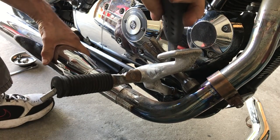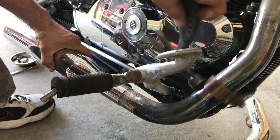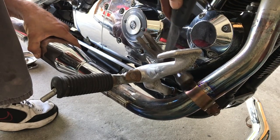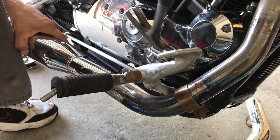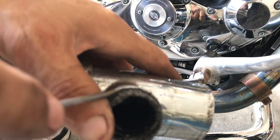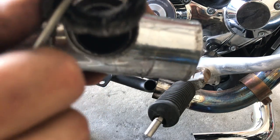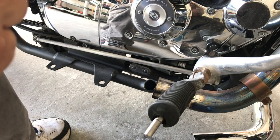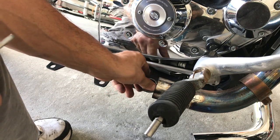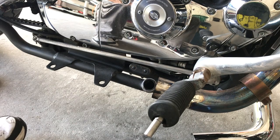Take your hammer and do little taps — don't go crazy, you don't want to dent it up. With the penetrating oil that's been placed in there and slight taps, use a small screwdriver and work it: twist, work it, twist, work it, twist — go around the whole thing and before you know it, they'll come right out. Then take the gasket, go over to your crossover, place it on there, and mold it nice. Now that will get its form back — press it down and you're good to go.